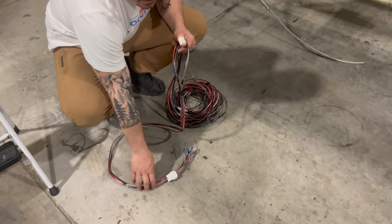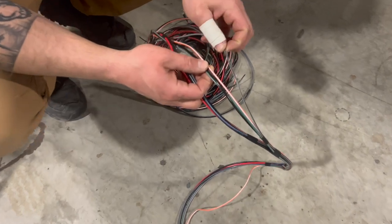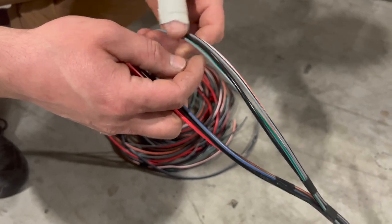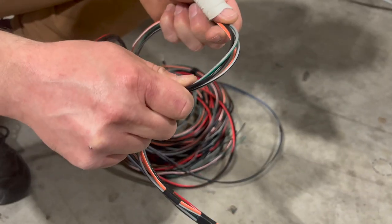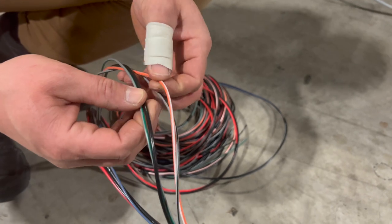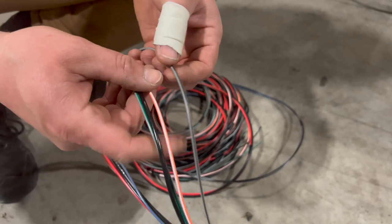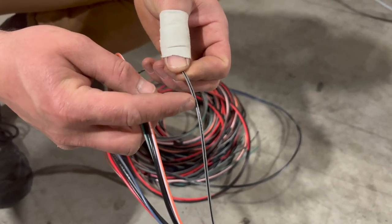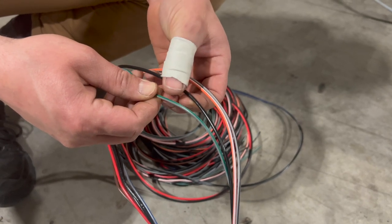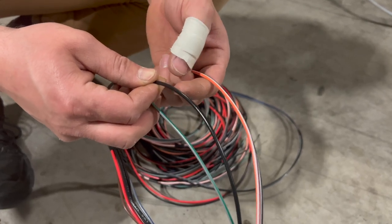At this split, this is going to go up through the floor to the console. The split happens and we have a gray with a black, an orange with a white stripe, a solid black, and then a gray with a green stripe. This section is going to go forward to the bow. The orange with a white is a horn — if I want my horn up in the front of the boat projecting forward I can run it up there. My gray with a black is for docking lights or headlights. My gray with a green is for my front navigation lights or running lights. And then this big solid ground is going to split up there and be my common ground for all those accessories.